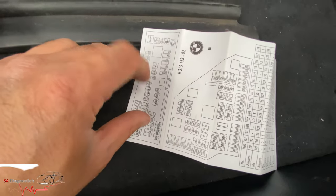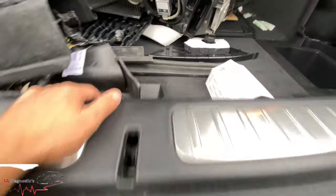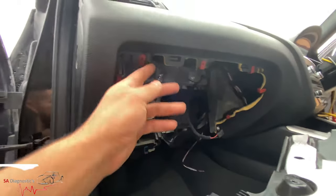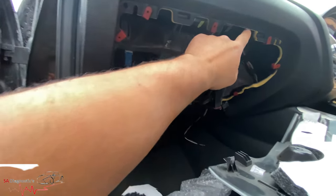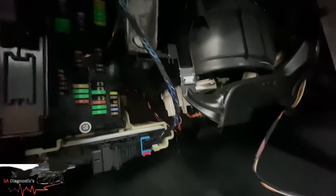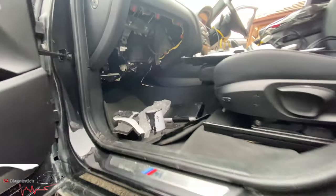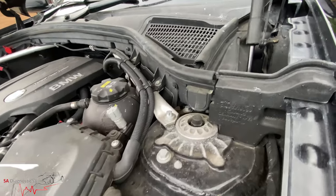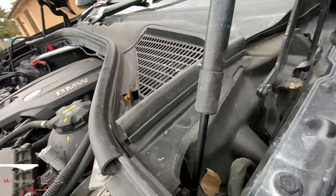This section here is actually found in the passenger compartment, right in here. You open the screws on the glove box, pull it out, and that is the remaining fuse section. There's another one as well — just under here — which will also open.